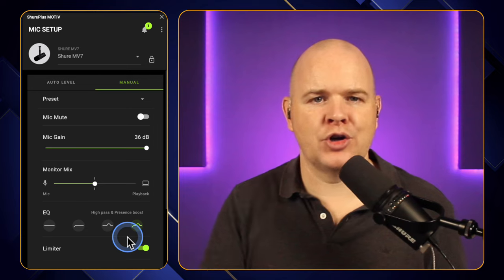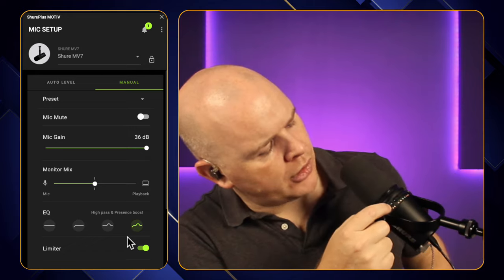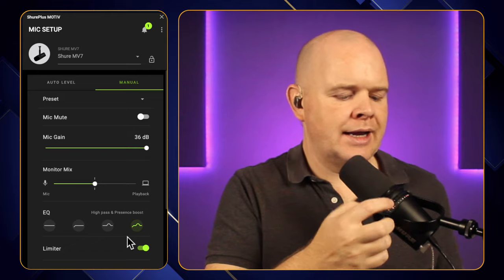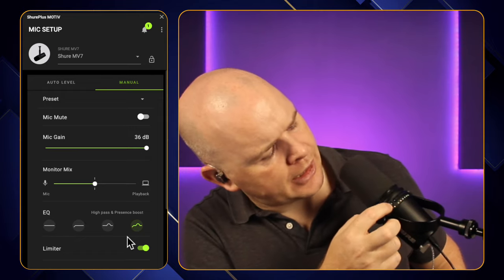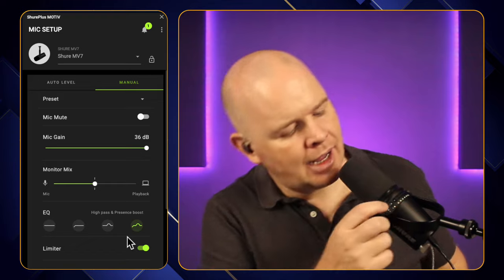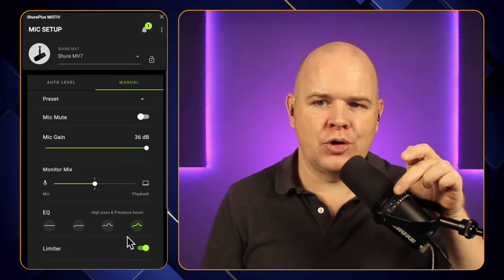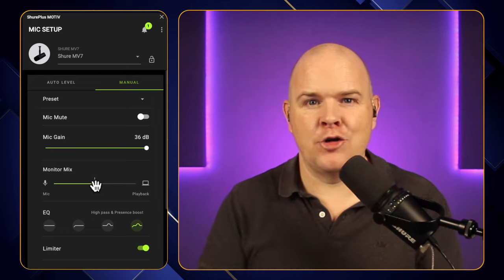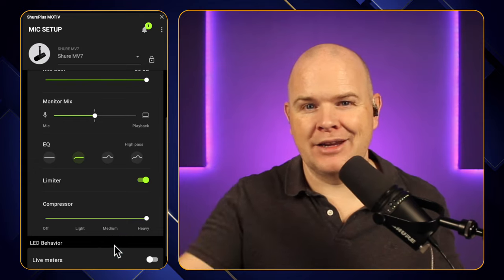The other thing is you have control over this on the device itself. On this side we have the little touch screen mute. And then on this side we've got one that has a picture of both a microphone and headphones, and this does two things. If I tap it once, it turns orange for headphones, and now I'm controlling the volume in my headphones. If I press it again to switch over to the mic, then what I'm controlling is the gain — I can turn that up and down. And then if I press and hold, I'm controlling the monitor mix. So you can control all of this that you're seeing in the app — I rarely open the app once I've got things set up. Then I just do any sort of control from here, or more likely from the computer.